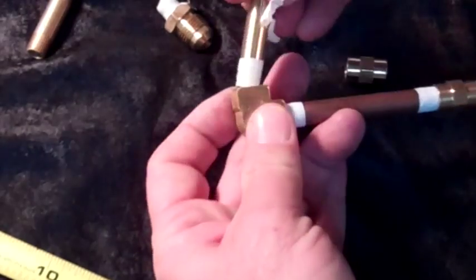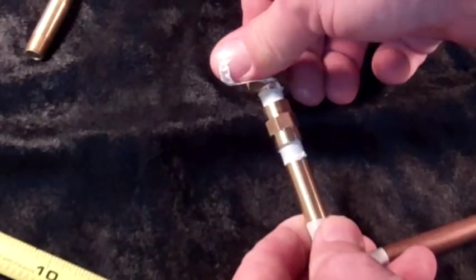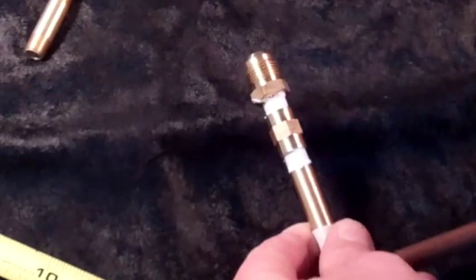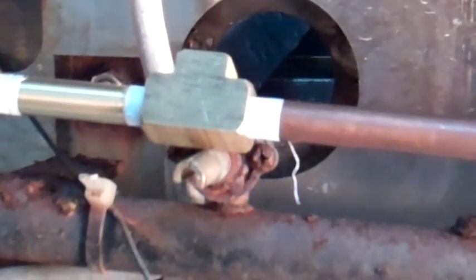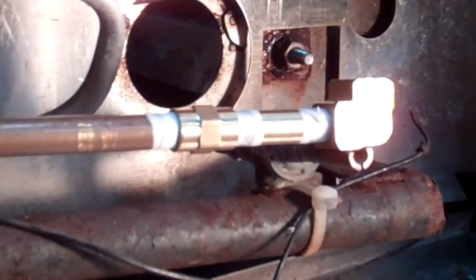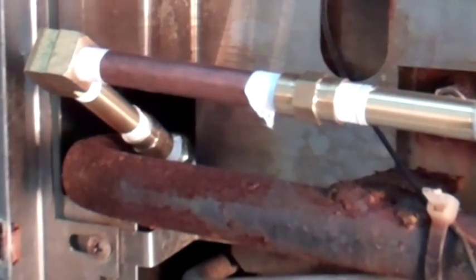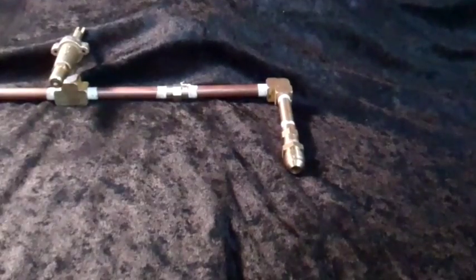On the end we'll attach a 90-degree adapter for the gas connection. With the manifold assembled, check, double-check, triple-check the valve position so valves are straight — controls must insert straight into the burners with the sizing exact.